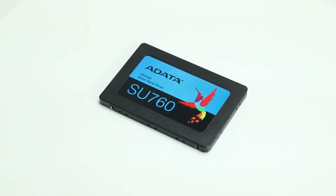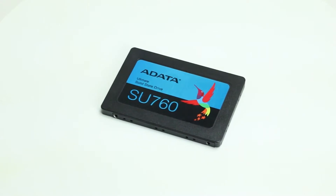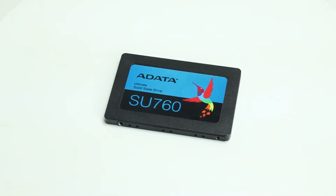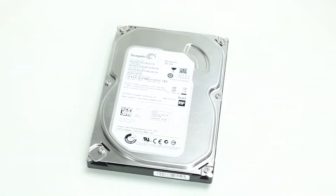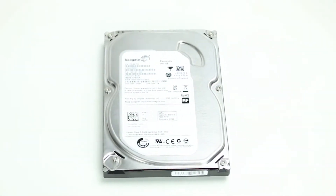The 7920's basic configuration has four 3.5-inch hot-swap hard drive bays and one internal 5.25-inch bay. Each bay can be used for one 3.5-inch drive, one 2.5-inch SSD, or one M.2 NVMe drive with the proper flex bay adapter.